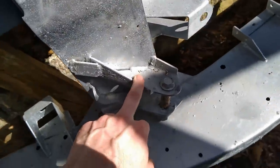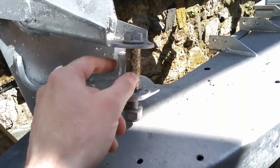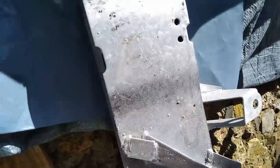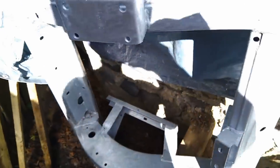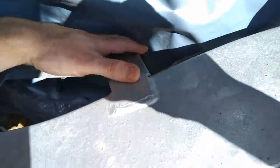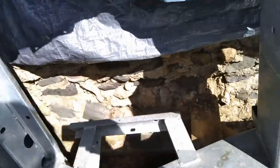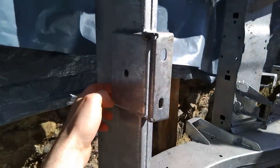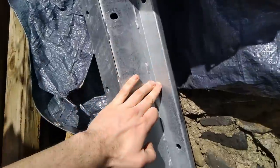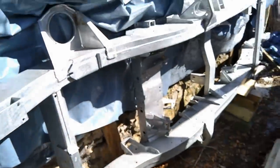The crows feet stay the same. The bushings are different — they give you a sleeve that you have to fit into your existing A-frame arms, or you can upgrade to the later larger bush. Coming back here, this is the 300 TDI metal fuel tank body support — they weld this on with legs here. The TD5 plastic fuel tank mounts remain on there too, so you can still probably use a plastic tank. This section is welded on for the front mount of the metal fuel tank, and this bar here is welded on for the metal fuel tank at the back. Those are basically the modifications Marsden make for a 300 TDI chassis.